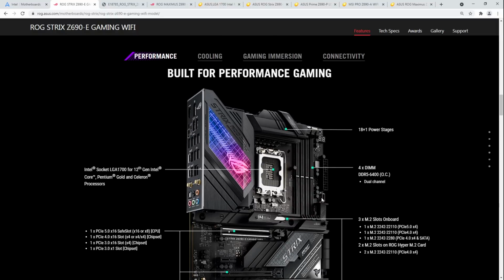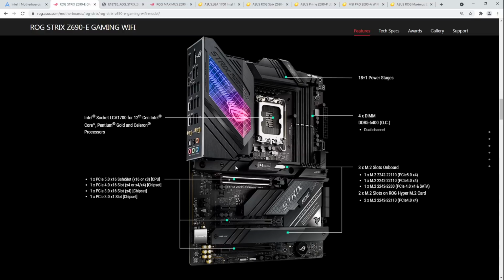I really dislike this motherboard because it combines one of my favorite features with one of the worst things a motherboard could do, in my opinion, ever, which is stealing PCIe lanes from the GPU to convert them into an M.2 slot. I hate it on B550 motherboards, I hate it on X570 motherboards, and I also hate it on Z690 motherboards. One of the main reasons I don't use the B550 Unify more is that it doesn't have enough PCIe slots. Right? Actually, even this doesn't have enough PCIe slots, because you have X4s, and X4 PCIe slots aren't good enough for some things.